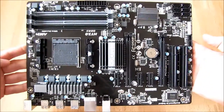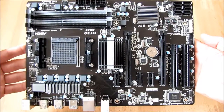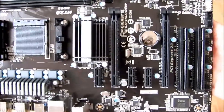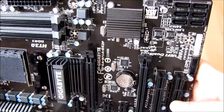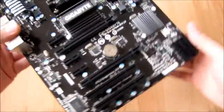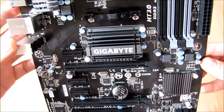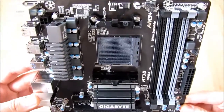The motherboard is ATX format with socket AM3 Plus and AMD 970 and SB 950 chipset and supports the AMD processors for socket AM3 Plus and AM3 on both 32 and 45 nanometer technologies. Supports up to 4 RAM memory modules with a maximum capacity of 32 GB, and it has native support for 1866 MHz and with overclocking until 2000 MHz.